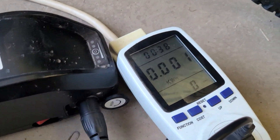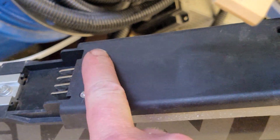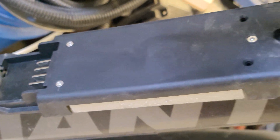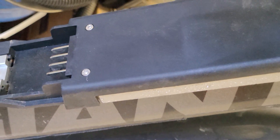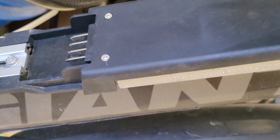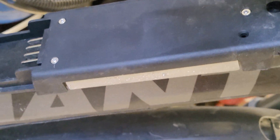I'm going to upgrade the wiring that goes into this mount. Right now it's only 12 or 14 gauge — I'm going to upgrade it to 8 gauge. Everything else on the bike comes factory with the Bafang motor at 12 gauge. I need to take the cover off with three screws, undo the wires from the positive and negative posts, heat them up, pull them off, and put the bigger wire on. The mount will be good for over 30 amps.